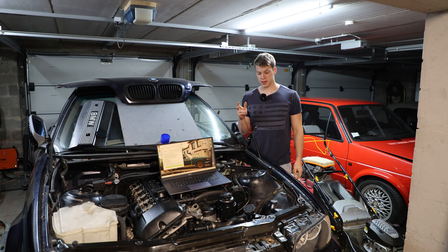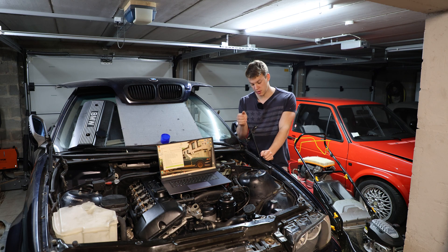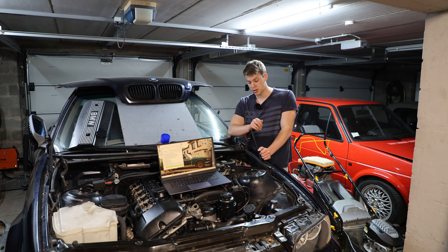So this was a very brief and bare-bones introduction to the basics of MS43 flashing. MS42 is pretty similar and I'm going to do that on my brother's car, the old 323i. Unfortunately we're not going to get to tuning the ECU today because I still need to fix the lumpy idle — I think it's due to either bad wiring or throttle body issues. I'm also going to change the crankshaft position sensor, since I mixed up the old one from the donor engine with the new one I bought. There's no point in tuning the ECU when the engine isn't running right. The rough idle is not related to the ECU — the issue lies somewhere else. See ya!